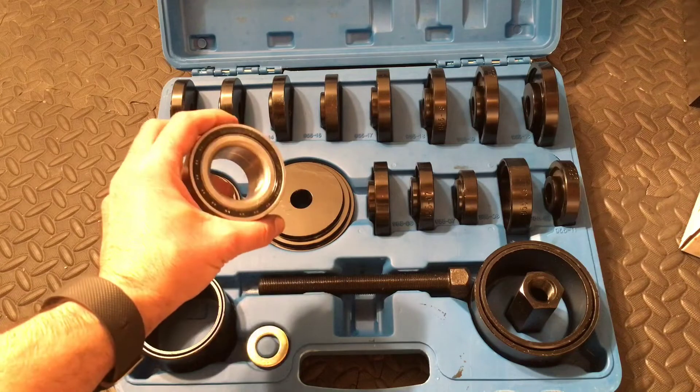Everything has been pressed in. Let's go ahead and take this off and take a look at it. You can see here on this side, everything is pressed in nicely. We have the retainer ring nice and secure. You can see there the spindle and the hub shaft coming through. On this side here, looks good — moving nice and smooth, nice and secure, nice and straight. I'll go ahead and get a close-up so you can see how far we pushed that in.